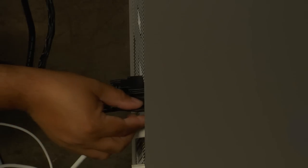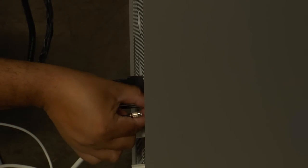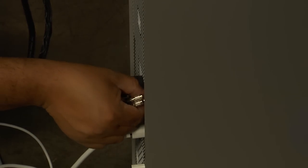To get started, we first have to open our Mac Pro. The first thing you'll want to do is make sure you've disconnected the power cord. I like to unplug both ends of the power cord before moving forward. It might also be easier to work with the machine if other attached cables are disconnected before we tilt the machine on its side to open it up.